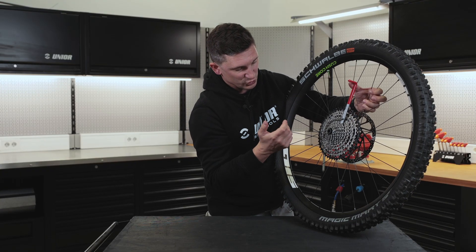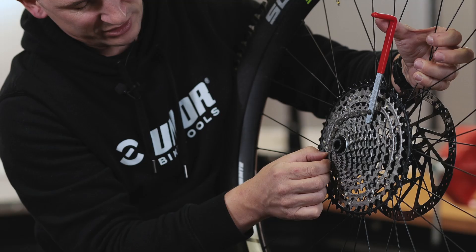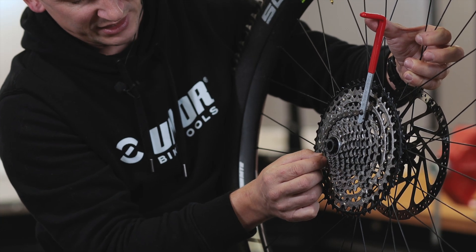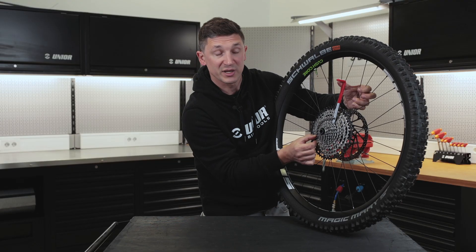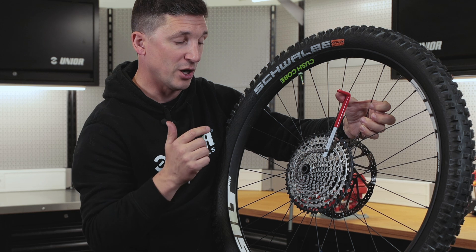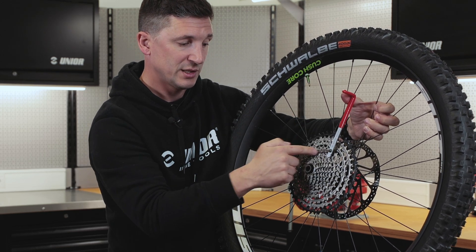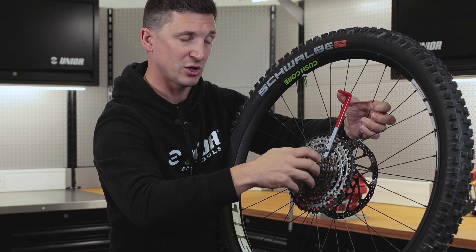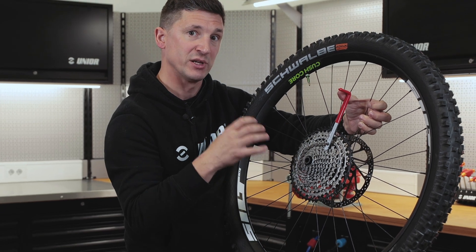When you find yourself in a situation when the last part of the chain does not fit onto the cassette cog perfectly, meaning that it stands on top of the chain tooth, that means that your cassette is going to need replacement. A third option would be also when you apply a force that the chain of the cassette wear indicator skips a complete cog of the cassette, which would indicate that your cassette is heavily used.